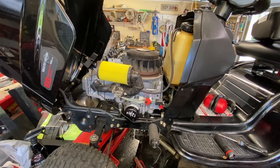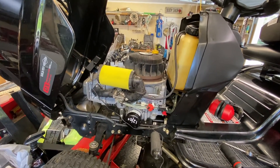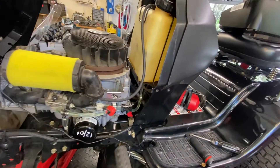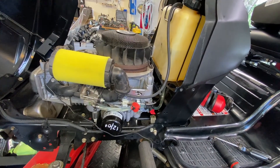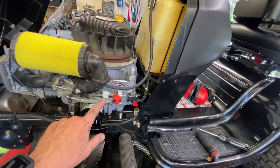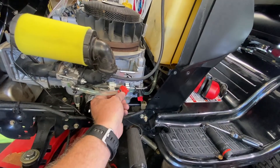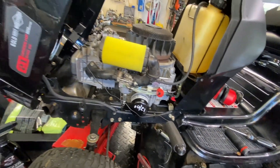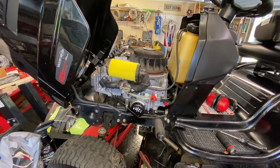Basically that's it. I'm not advocating anybody doing this themselves — you do this at your own risk, don't blame me. I'm just showing what I found and what I'm doing to solve it. Now I have to put all this back together and then take it out for a try. I changed the oil, changed the air filter, put oil in it, so we're ready to go. I didn't see any need to change the spark plug. I did the fuel line — good quality clear fuel line I use on a lot of bikes. The spring hose clamps don't fit that particular line so I just used zip ties, which is fine at a few miles an hour. If you like what you see, give me a thumbs up, subscribe, and catch you on the next video — thanks for watching.